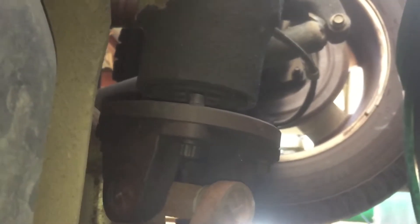I should have looked closer, but we have got a pinion seal leaking here. Let me see if I can show you - there, you can kind of see it. Pinion seal is leaking. So before we throw a hundred and some odd dollars worth of fresh gear oil in it - it's not dripping now, but eventually it would have been dripping. It would drip gear oil in the back. There was still a bunch of fluid in it, but I just thought I would show - it is leaking.